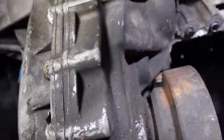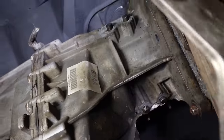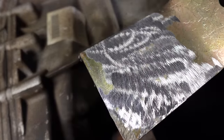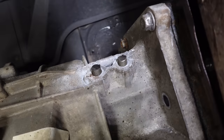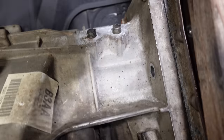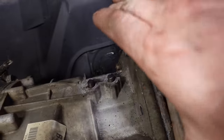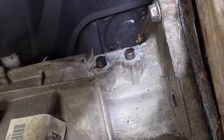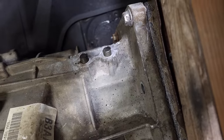And then I can just hold this plate up to the bottom of it, and then tack those plates to the back side of this, and then use those plates to drill the holes in this plate. And that way, I don't even have to get out my tape measure. I just drill them in the exact same spots using all the old pieces as templates, and that works for me, because it's on an angle, measuring is too complicated. You gotta think and stuff. Here you just do stuff and you end up with a perfect result.